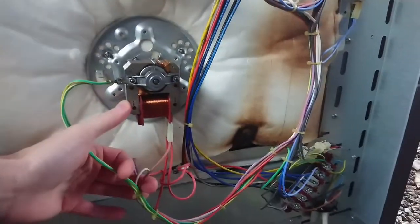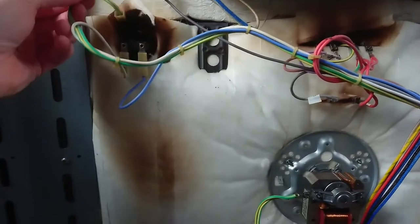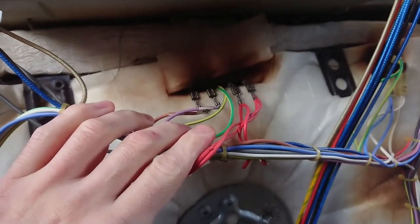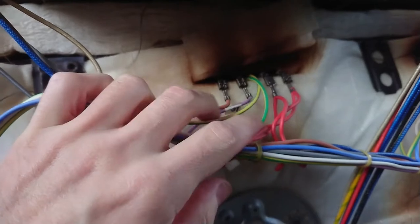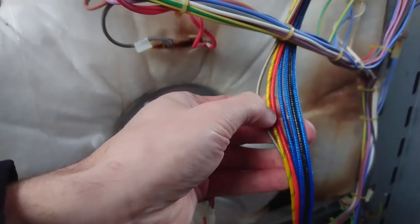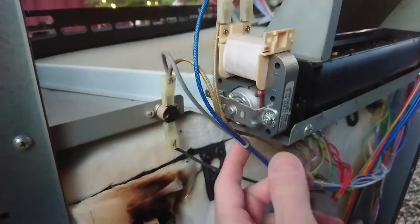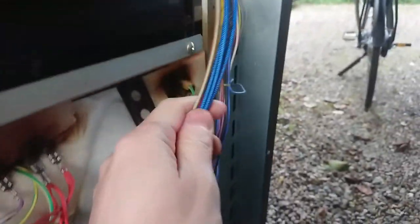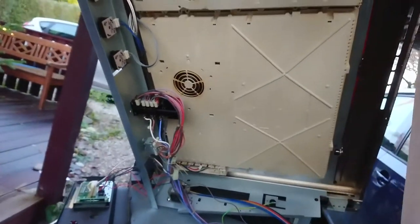The wiring goes off in different bunches. We have an oven fan, some temperature switches, and different lights. As you can see, some areas are pretty burnt — there's too little heat insulation around places where plastic is used. At the heating elements, they avoid plastic for that reason and use silicone wire or fiberglass-reinforced heat-resistant wires. This interesting bundle goes to the induction stove, not to the open-frame motors you see in typical kitchen appliances.